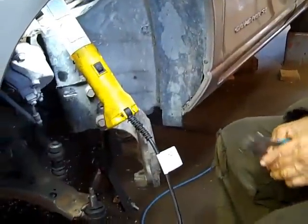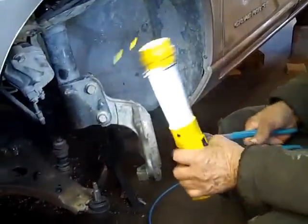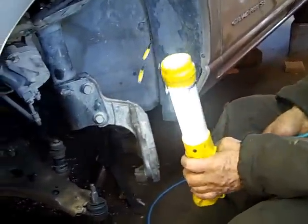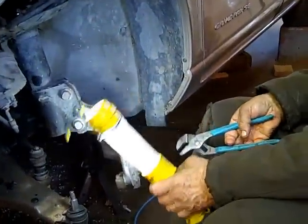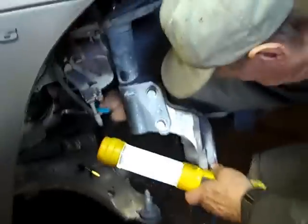The other one, the replacement one, I put in and just got to put in a new filter, and I'm going to replace all the seals, the 2 seals on the ends, the one right here and the one on the other end. And okay, now we're going to put the other axle back in. Got one in already. I thought I better show this one. Transmission's in there. All the mounts are bolted down. Gotta put the axles back in now.